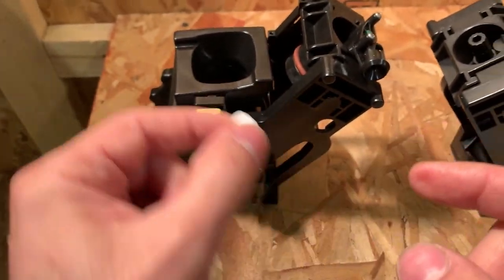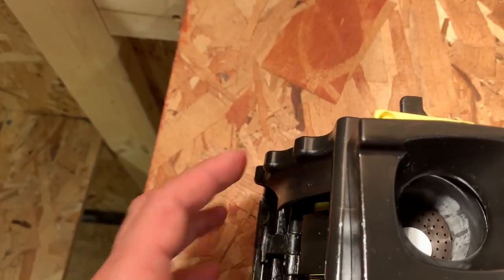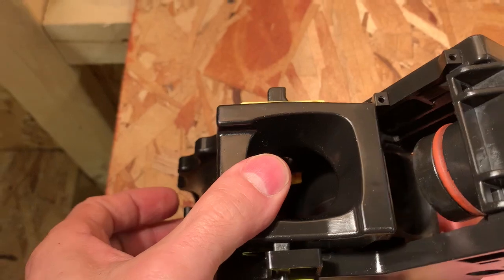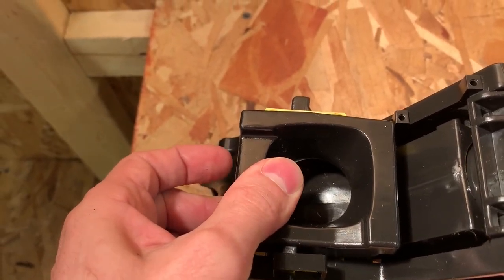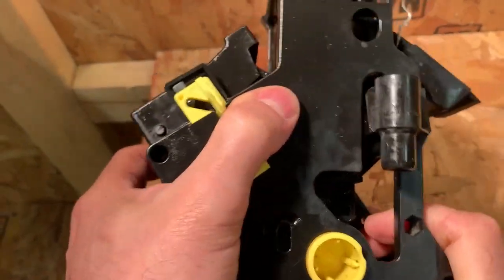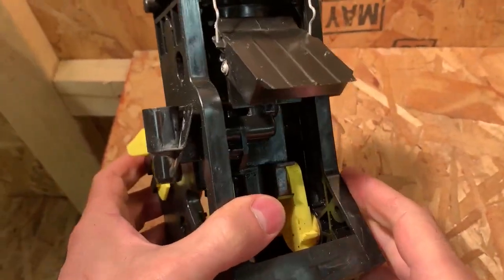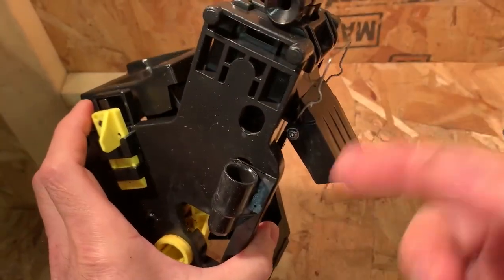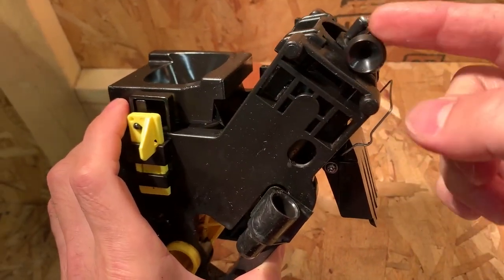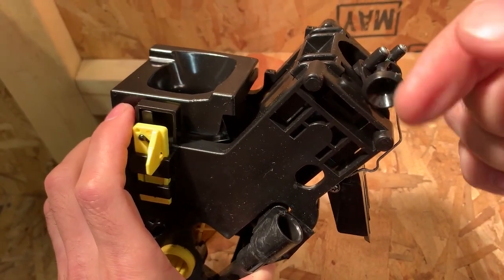You put the pill through the decaf chute — it goes into the brew unit — then as you create the cycle, the brew unit will cycle into brewing the coffee. Whether you use the pre-ground option or the cleaning option, they'll both do the same thing. The cleaning option is a little better because it will run the water through the system on and off, and as the pill melts it'll clean out everything inside the brew unit plus whatever is in the spout area.